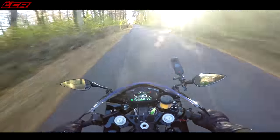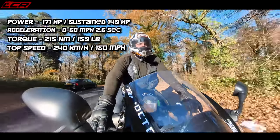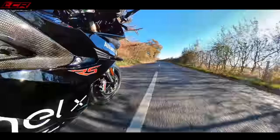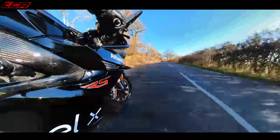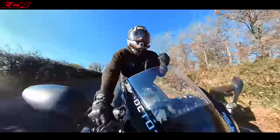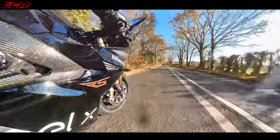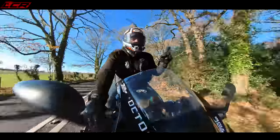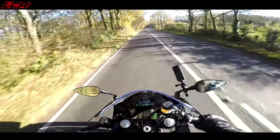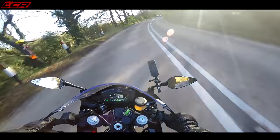Let's go through some specs: 215 Newton meters of torque — that's Rocket Three torque levels, incredible amounts. On electric that power is available immediately in theory as soon as the motor starts spinning. But from dyno runs I've seen on earlier Egos, you don't get full power instantly — it's a slow ramp up. They actually limit that torque until you're going faster, because it would just be spinning and tie itself in knots otherwise.